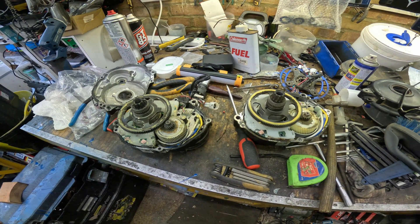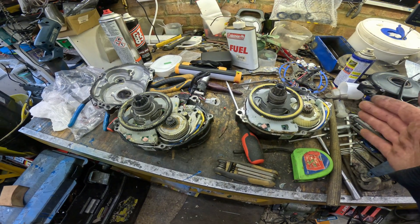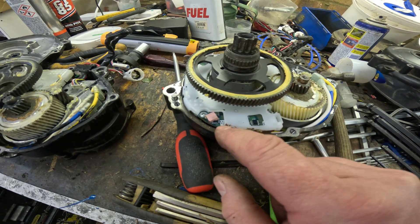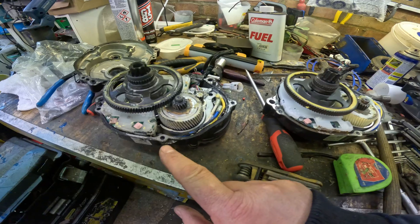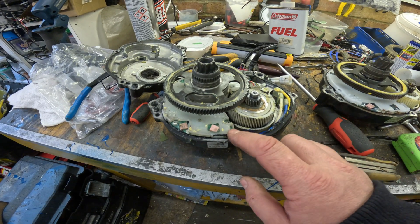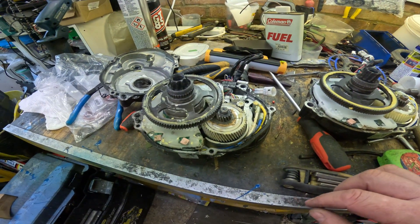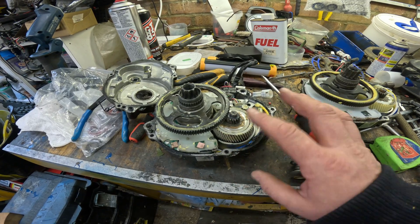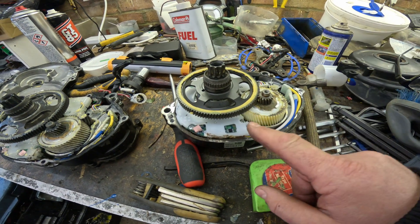I just don't believe it. I've got them apart and this motor is really new - came from a dry rider, was secondhand, but it's only done a thousand miles and it's already got rust staining in the bottom from water ingress, right on the edge of the circuit board. A little bit more water getting on that circuit board and it'll be throwing errors. If you look at my previous video - I'll put a link - this one got water in it at 1200 miles. I quickly split the case, chucked it in an oven, dried it out, the errors went, and then I set about servicing it and improving its waterproofness. So whereas this newer one's circuit board should be all right for now, I'm still going to replace the bearings and waterproof it properly.